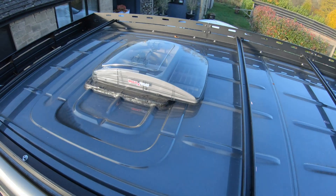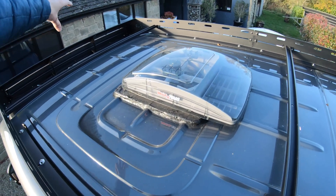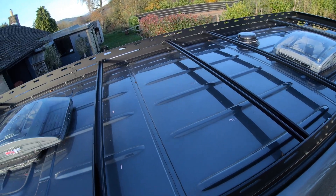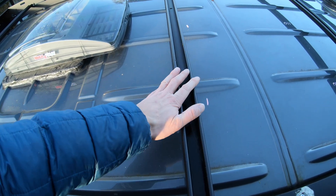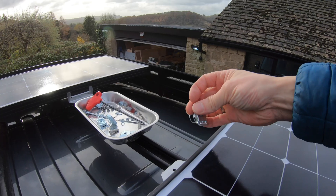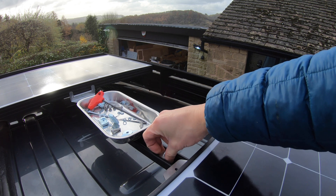I'll show you where these are going. On the roof we have one solar panel going lengthways down the van there, one going lengthways there, and then two going across the van here and here. We've got a mule roof rack, but essentially this will work with a uni-strut roof rack as well because the supports are just uni-strut. The components include these M6 Zeb nuts, which fit inside the uni-strut and act like a nut so you can bolt into those.